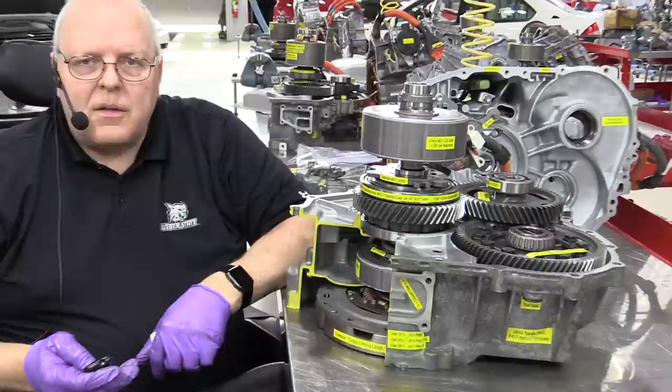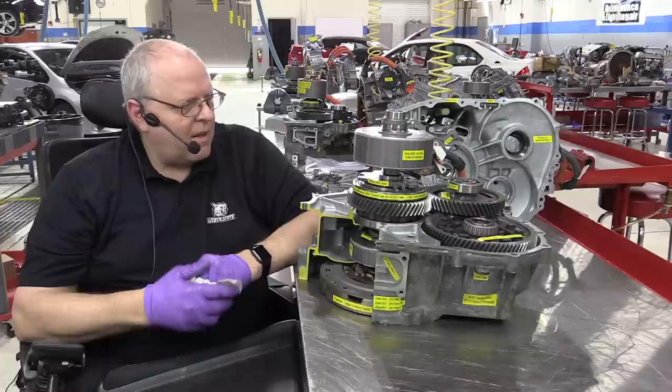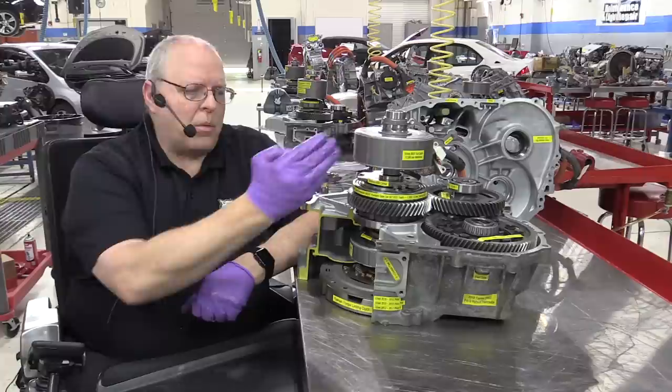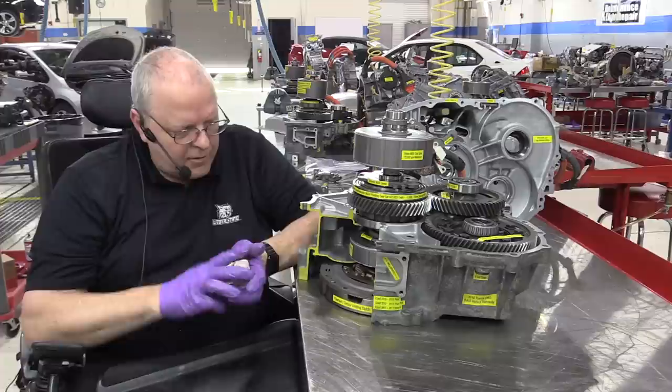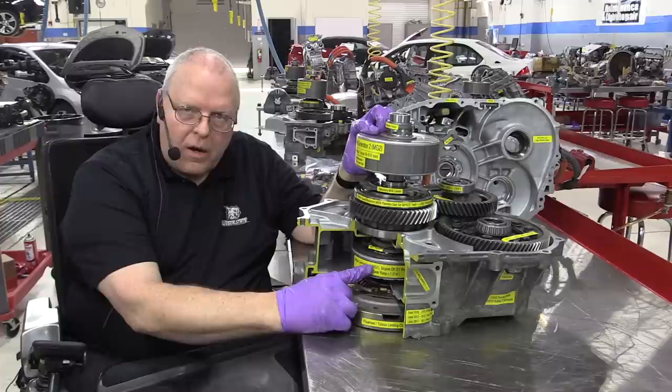So the name of this second gear set here, the motor speed reduction gear set, makes no sense to me. It drove me crazy for quite a while, thinking, why would they call it a motor speed reduction gear set? Because all the descriptions in the Toyota service information say it's to reduce the speed of MG2. Well, obviously it doesn't. It sped it up by a factor of 2.6. Instead, after playing with these transaxles and doing calculations, what it does is it reduces the speed of MG1. I believe there's a typographical error in the Toyota service information that's just been propagated on and on and on.